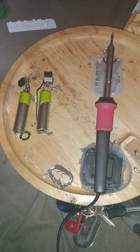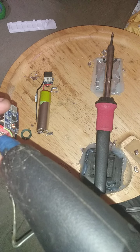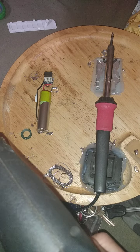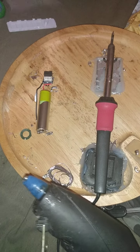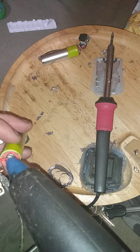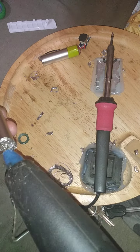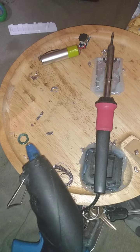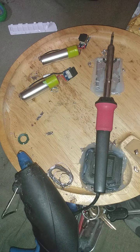The glue gun should be ready now — yes, we're getting glue. What we're gonna do is pull this aside and hit right here with a whole bunch of it. That's all you don't want to do more than that. You just want to cover these contacts so that when it's locked in the casing there won't be any shorts. But you also don't want to glue it into the casing because it's going to be really hard to remove. It's actually designed not to need to be glued in.